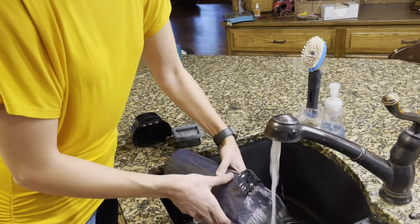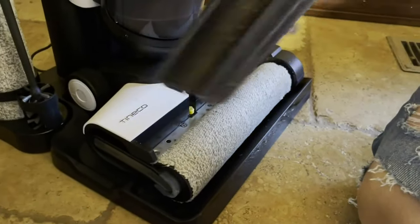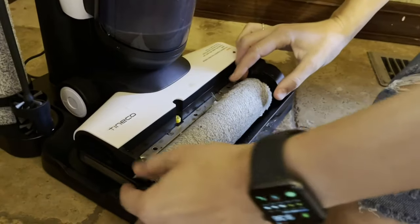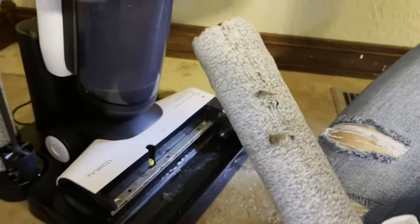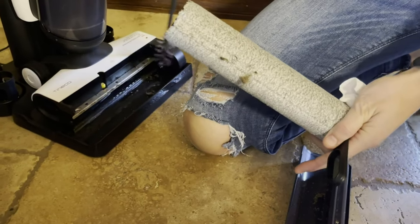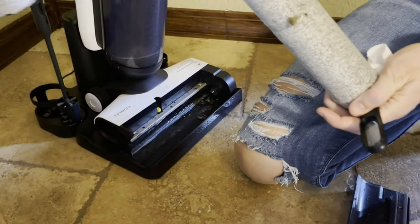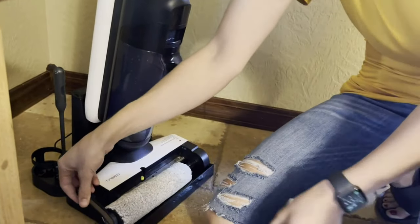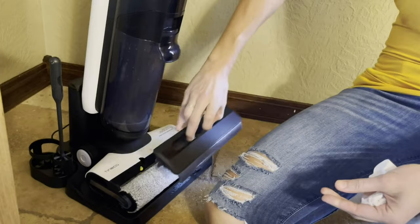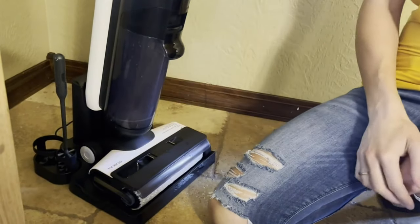It does say not to put it back while it's wet. The next step is to clean out your roller: pinch these two things together and this little cap comes off. Here's the roller — you just slide it off. You've got all this stuff in here and you can clean out any hair or debris to do a better job next time. After you clean this out, they don't want it to be wet when you come back, so they've given you an extra one. You get your extra roller out and place it in there — it's got a little snap. Once you have the clean one in, it snaps into place and you're ready to start back over.